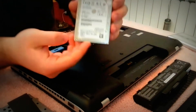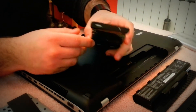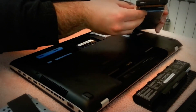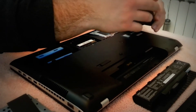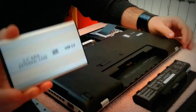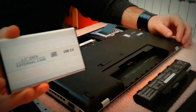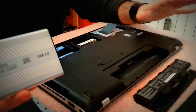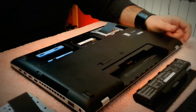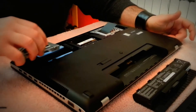The original hard drive I decided to keep inside. You can see it connects here. I recommend that when you buy an SSD and decide to install the operating system on it, just keep your old HDD with the operating system inside. That way, for any kind of trouble, you can plug the HDD back in and restart your computer without any problem.